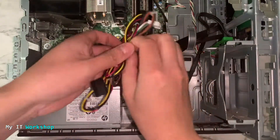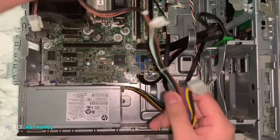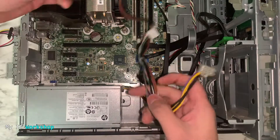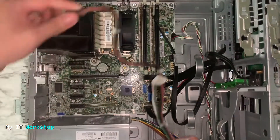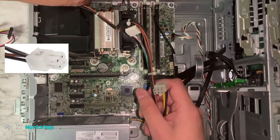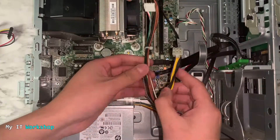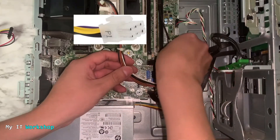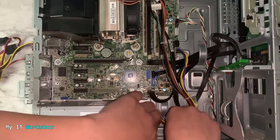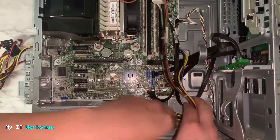The new power supply has a rubber band on it — allow me a few seconds to remove it so we can continue. The yellow, black, and red cables we don't need just yet. We follow the cables like we did before and connect them back. I advise you to take a picture if you have many cables or if this is your first time, so you remember the layout. Now I'm connecting the cables back and placing them under the holders so it looks tidy.